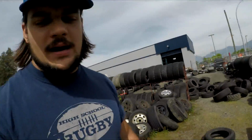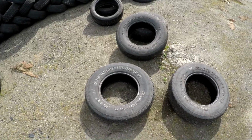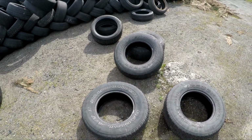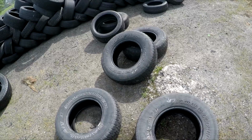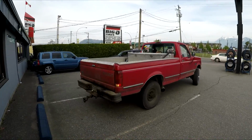So what I'm thinking, guys, is with these bigger tires now, the gear ratio is gonna make the car even slower than it already was, which is just pretty bad. I actually do have a 410 gear set sitting around at Jake's house. I could put that in if I wanted to. It would even out with the bigger tires and keep the same kind of acceleration. I probably should, but we'll probably test it out with the big tires without that and see how it goes first.